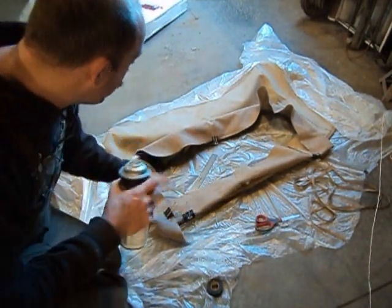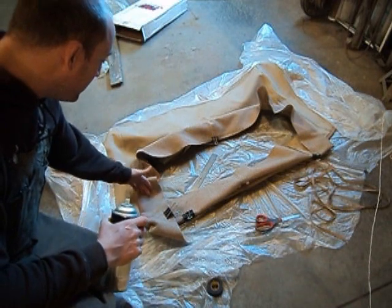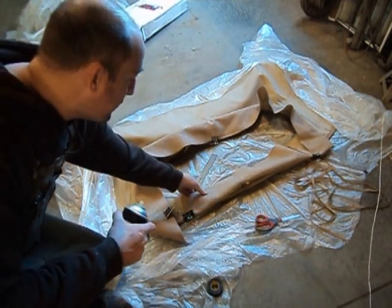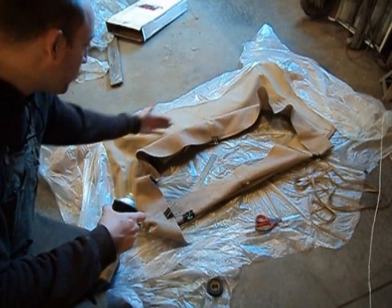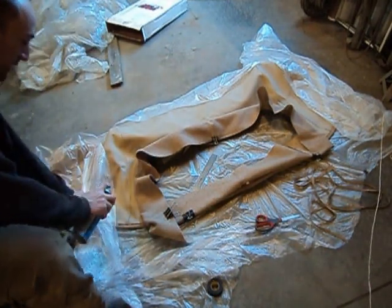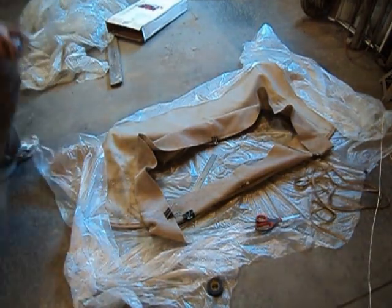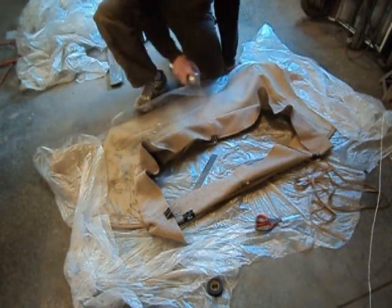I've folded a bunch of the fabric over so I'll explain where we're at. This is the top of the back window, this is the bottom — we haven't changed orientation. We want to use adhesive and glue this part down to the inside of the convertible top. I folded over the rear piece so we wouldn't get any adhesive on the face of it or on the rubber around the rear window. I folded over all this stuff, spraying the back of it, using plastic to cover where we don't want glue. We'll let it set up for 10 or 15 minutes and then come back and glue it all down.